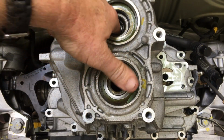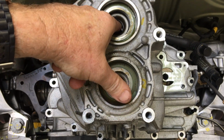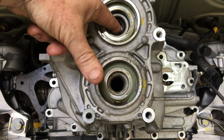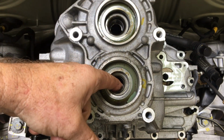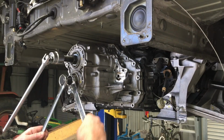Interestingly, with the little circlips that live in these holes, the one at the top here was the one that popped out really easily last time. I just hit it with a screwdriver with a mallet and it turned at 90 degrees and I pulled it out. This time I just could not get it out. Nice thing is that that's at the end of the thread, so I don't really need to remove that. Whereas this one here, it came out more easily. So I squeezed it together, got a screwdriver underneath it, and then just levered that out, and they just popped out really easily.